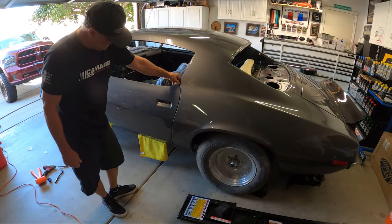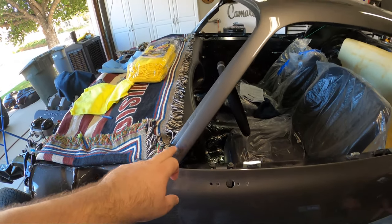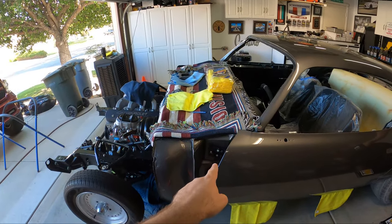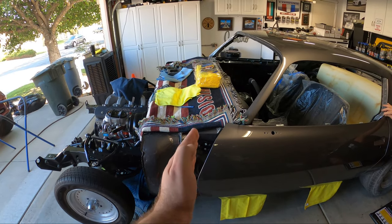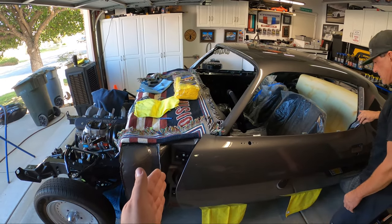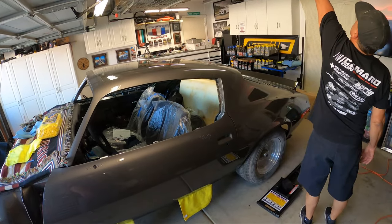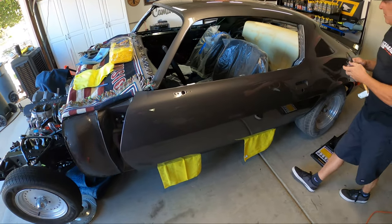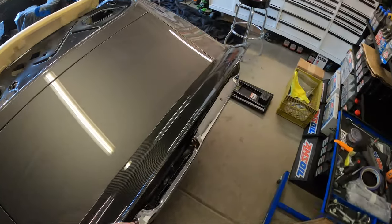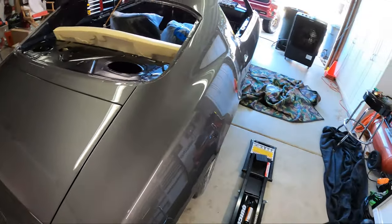I think we got it pretty close — there are a few more adjustments to do. On this side the gap needs to close on the passenger side, so we need to lift up. The little metal plates inside the front door move around up, down, side to front — there's a lot of play in those metal plates, and we also have play in the door back and forth. Everything's looking pretty aligned. Look at the spoilers, nice and lined up — it's perfect.